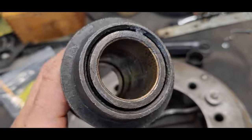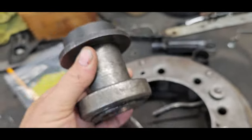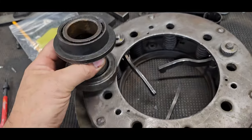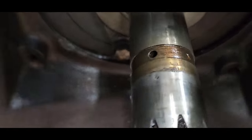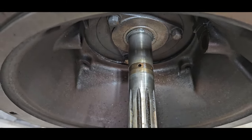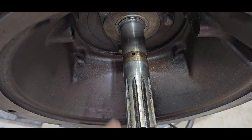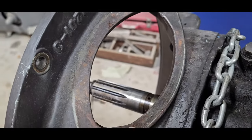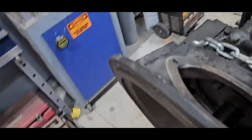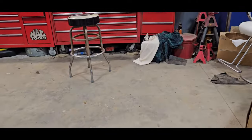This is an oilite bushing, and it appears to have either graphite or mild cast iron in there. They didn't have grease technology the way we have it now. What they did — and you're not going to believe this — is the input shaft is hollow right here and goes into the transmission. So you have your transmission fluid constantly seeping through to keep the throwout bearing lubricated. Part of the procedure to clean the clutch was to pull this cover off after so many miles and pour kerosene down into it — the thought was it would clean the transmission fluid off the friction plate. Mind-boggling the way they did things back then.